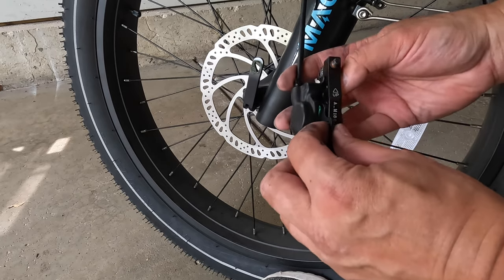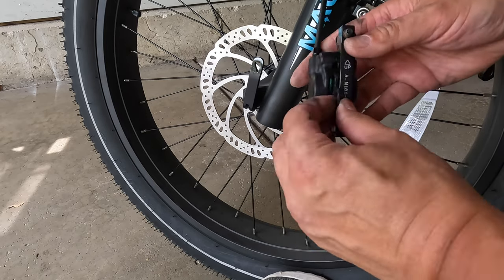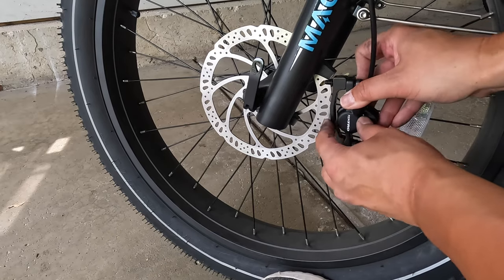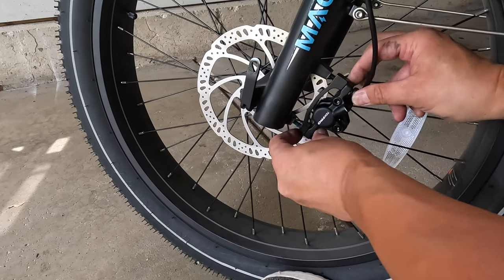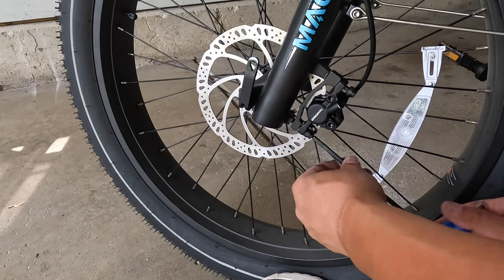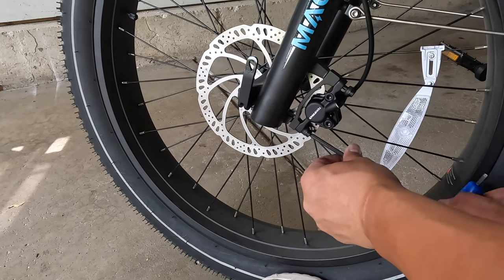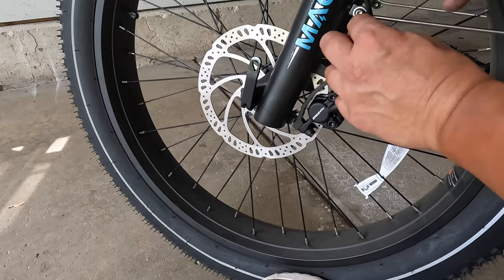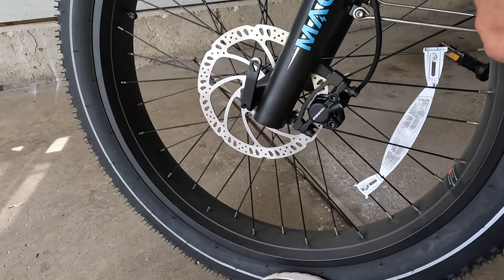We're going to remove this pin, but we don't want to squeeze the brake lever when we do that — that'll open up the brake pads right here. We're going to put that between the rotor and then just tighten this back up again. I'm going to loosely put it on here, not totally tighten it, because we have to align the brake pads to the rotor. We'll keep it fairly loose for now, and I'll rotate this around so that when the wheel turns, this cable is not going to get stuck.